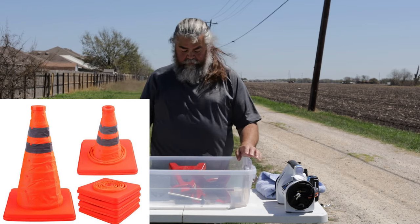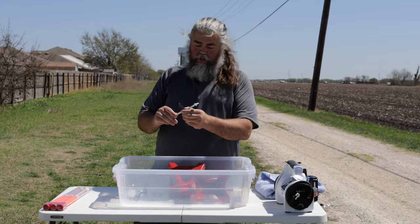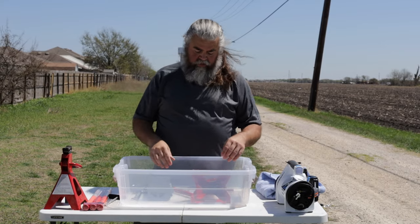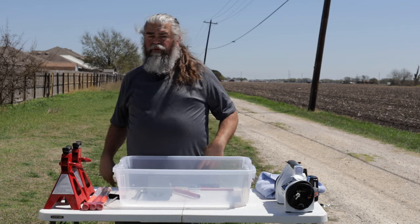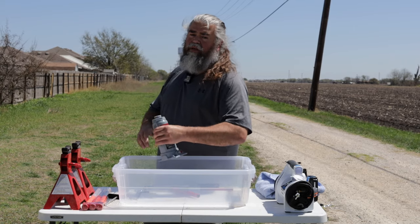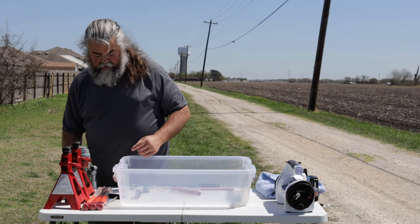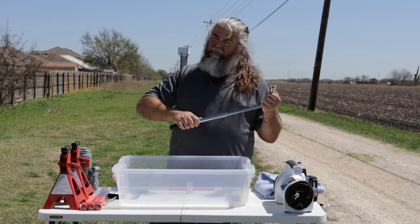We lost our lever to pull for the black tank — I bought a new one and it came with a secondary short one, so I threw that in the kit in case we ever lose another one and need to dump the black tank. These jack stands came from my garage. Anyone who's done real work on cars or RVs knows it's a good idea to have a jack stand. Don't rely on your stabilizers — they are not meant to support the weight of the RV — and don't just rely on your bottle jack either. If the jack gives way while you're under something, you need a backup, and that's what jack stands are for.